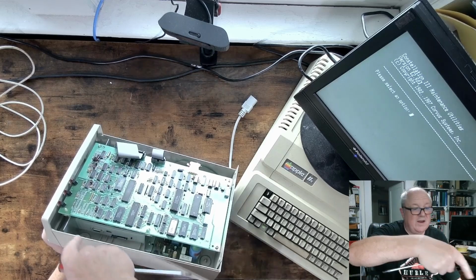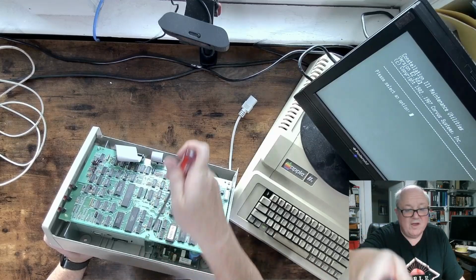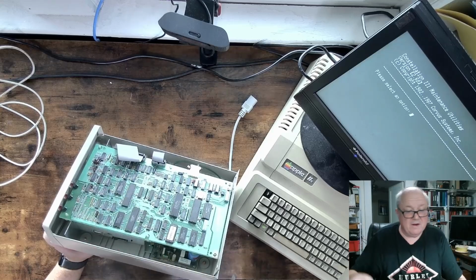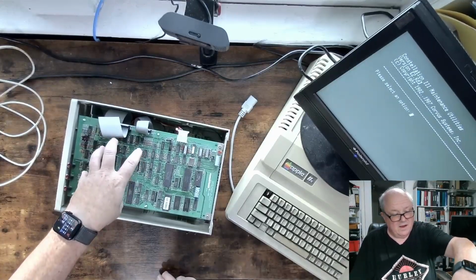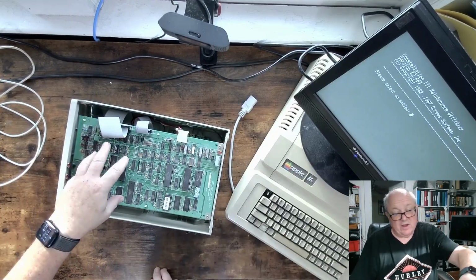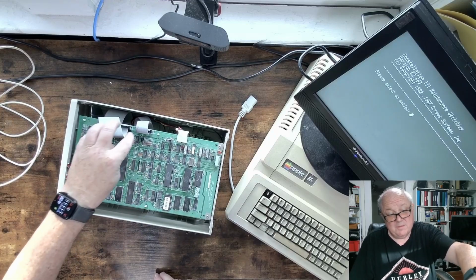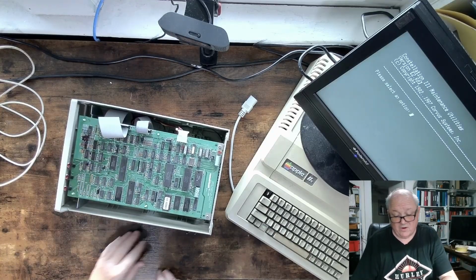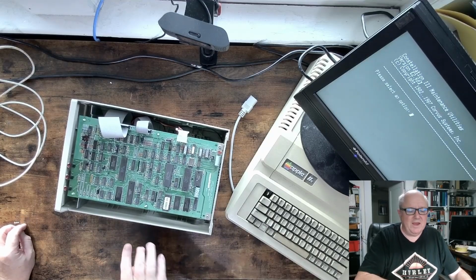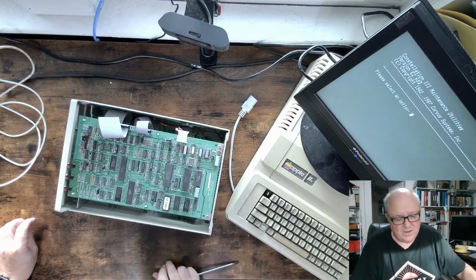And so, this is sitting in a 3D printed plastic tray that's 5¼ inches wide, like the original hard drive. So it mounted on the boards and has an MFM interface, but that is a DREM MFM emulator, and it can actually emulate both a hard drive and a floppy drive. It has two connectors, so it can emulate two hard drives. So if you put this into a PC or an XT, it could emulate all your floppy drives and all your hard drives using a single emulator.